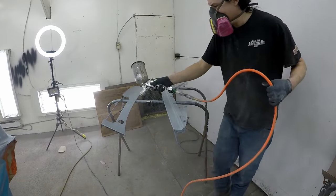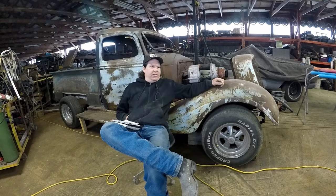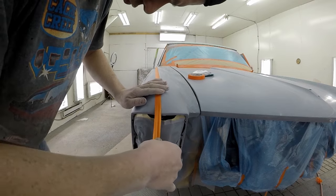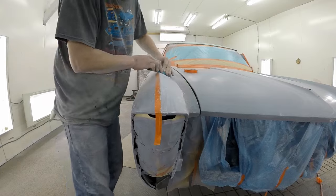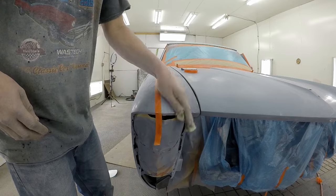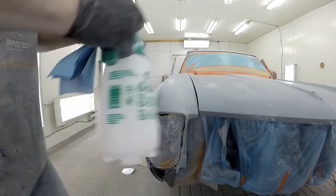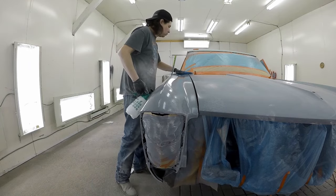Here's a quick shot of the final little touch-ups and tweaks on the front fender eyebrows. We had a little operation going on in the past videos — just tuning it in, finally honing it in. I like to put tape down on the peaks so you can really see where you're at, then go up to it and repeat on both sides. Finished dressing it in 600 grit after that and gave her a good wash down. Blowing off the car, cleaning it all up — ready to go.